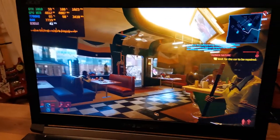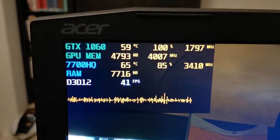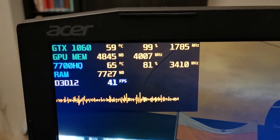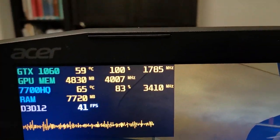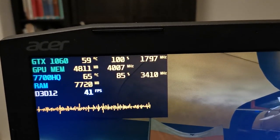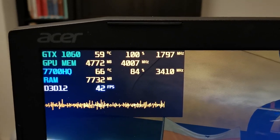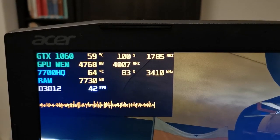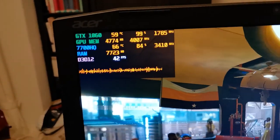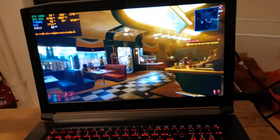After around 20 minutes running Cyberpunk in this scene, we're getting 66 degrees for the CPU under full load — so no throttling at all — and only 59 degrees on the GPU. However, FPS is not really affected because the GPU boost clock is no higher than before. I can only explain this by the power limit of the laptop motherboard: the GPU simply isn't getting more energy so the boost clock won't increase, even at just 59 degrees. So the next step is to try overclocking the GPU, which normally I can't do in this laptop because it immediately throttles down when overclocked.